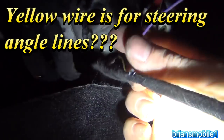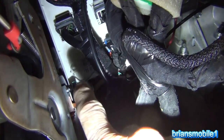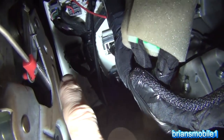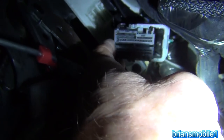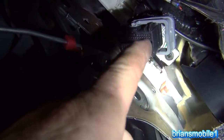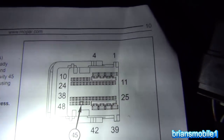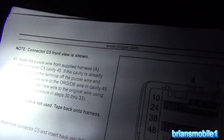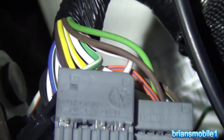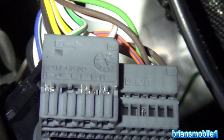Tape up the yellow wire, and then the purple wire is going to go up to that plug right there. There's a landmark doohickey right here, and when you go up above that you go nut, doohickey, and then this guy is the one we're going to unplug. On this side where my thumb is there's a little buckle, and this whole black outer casing — say it's a backwards C — comes off that way. Then you've got two plugs in there: the gray one you need access to and the other one. Looking at the instructions, you have those heavier wires along the bottom of row 38-48. Count over one, two, and there's something there — it could be an orange and dark blue wire, and it almost looks purple. That pin right there is what we need to splice into.